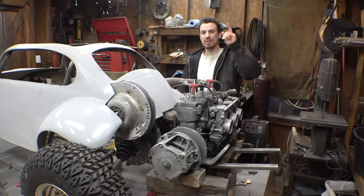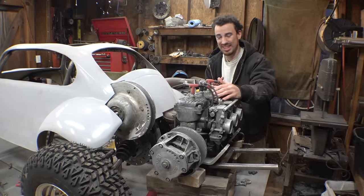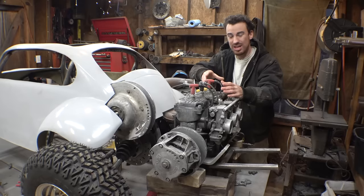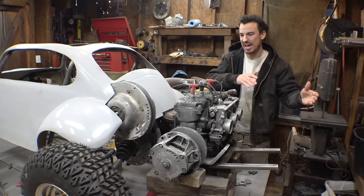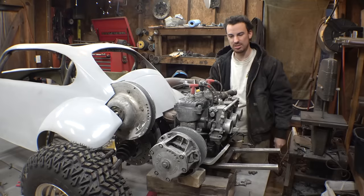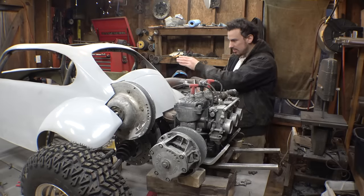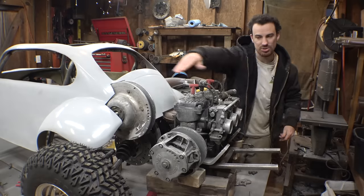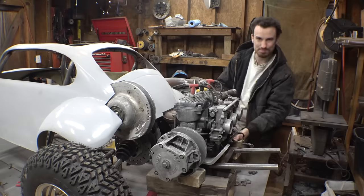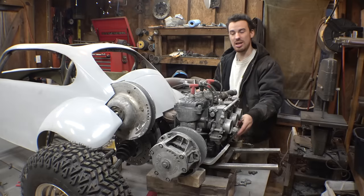So next video, we need to finish the engine mounts, because technically we only got half of the engine mounts, but that was pretty much the hard part of mainly just figuring out where exactly this thing's going to go, making sure that it's not too far back, trying to get as close as possible in the frame, but making sure that there's still room for everything. So next video, we will add more to it, because I want to have a hoop going from right here in the frame, going around the engine and then back. Then we'll bend these up to here, possibly add a little bit more tubing under here. We want to help protect this engine. Also possibly a giant skid plate under this thing. And then we can finish the other side of the engine mounts.